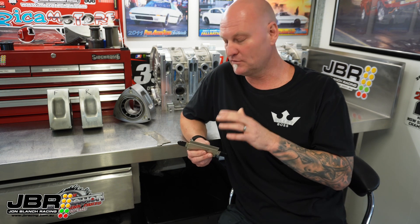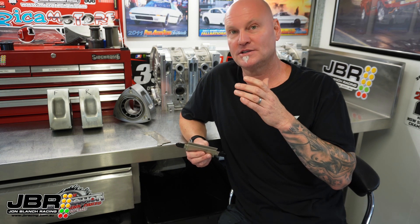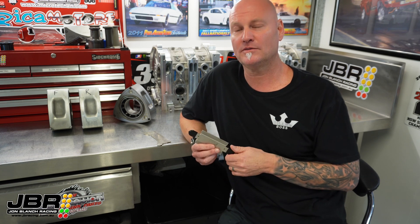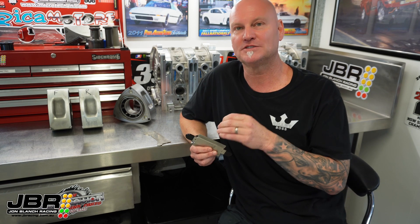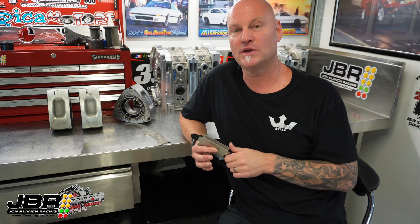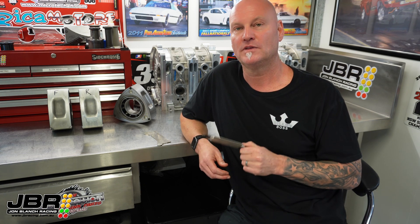When you start using one of these, you'll notice that the accuracy of the machining on the rotors isn't quite as good as it could be, and when you look at the small details there is a little bit of dodgy stuff going on. This tool will help you eliminate that and will go a long way to helping you build a better engine with better compression — so when it starts it will have plenty of comp, a better top-end ceiling, and better high RPM sealing.